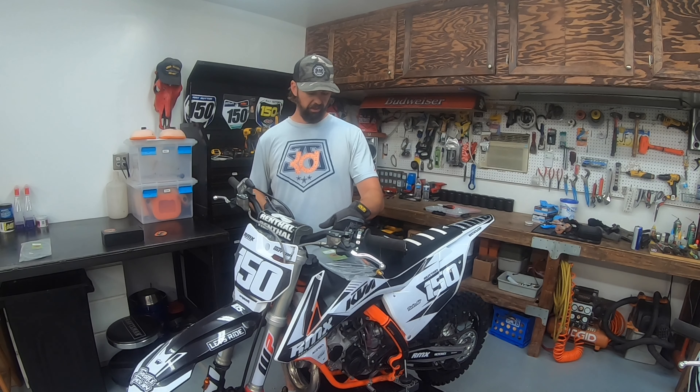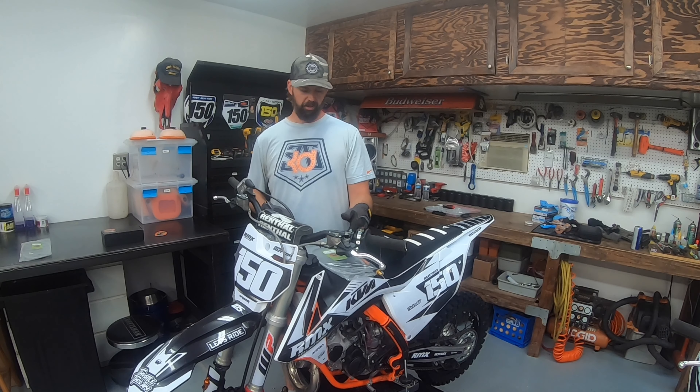Hello, my name is Ray Sutton. This is going to be an instructional video on how to install the T-Rex billet throttle on the KTM85. This bike is a 2021 and the throttles and cables are more problematic than they've been in the past, so I'm installing this to make things easier. First, take off the seat and expose a bolt underneath to the fuel tank — that's an 8mm. Take that out, and there are two 8mm in the front to release the side shrouds. Then close the fuel valve or petcock valve underneath the tank, disconnect that hose, and the fuel tank will come off. Let's get started.